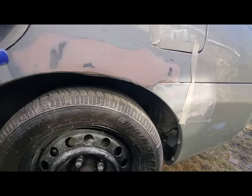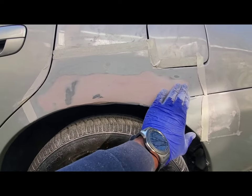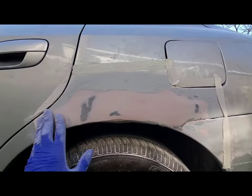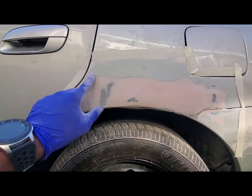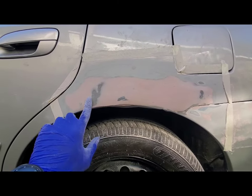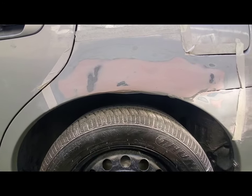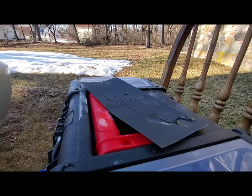As you can see, you can feel it — there's no unevenness anymore. That took some elbow and shoulder strength. This is about as smooth as you'll get it. I'm going to sand it one more time by wet sanding to ensure it's right. I took more time on the edges because that's where the filler and paint meet — you want to make sure it's blended correctly. Some areas were a little thicker than others, so we're going to wet sand it with 400 grit one good time to make sure everything is completely even.